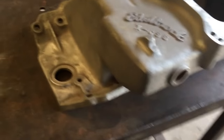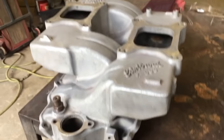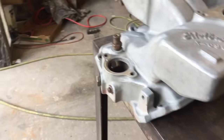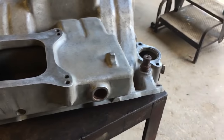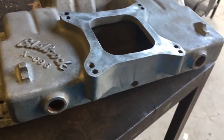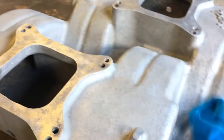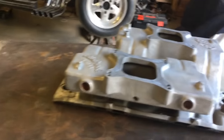Now I'm pretty satisfied — I've touched pretty much every surface with the Scotch-Brite pad, scuffed it up, got everything slick. So now I'm going to blow it off really well with air. You could also rinse it off with a hose or whatever you've got at your disposal. Then I like to take a clean rag — an old T-shirt or something — and put a little bit of lacquer thinner or just dampen it with water, and just wipe the whole thing real light to get any leftover dust off. Let it dry one more time and we'll be ready to spray some paint.